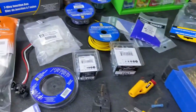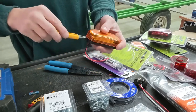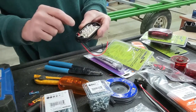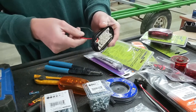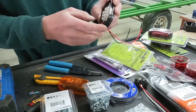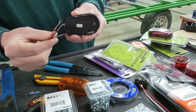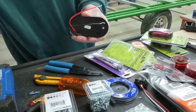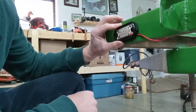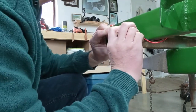With your clearance lights, use a flat-blade screwdriver to pop the lens cap off. You'll see two mounting holes and an indication of which wire is which — red is positive, black is negative/ground. We're going to drill two holes through the frame to fasten the light and another hole to run the wires. I've marked where I want the light to sit and where I want the wires to run — it'll cover up the holes from the old clearance light.